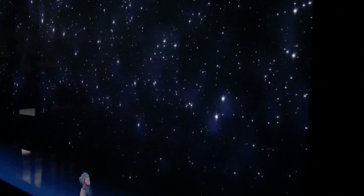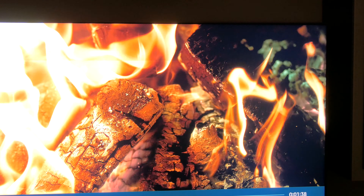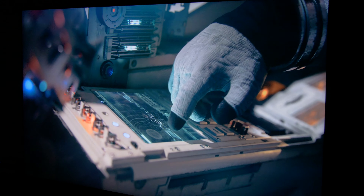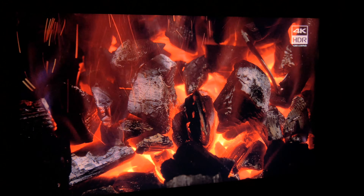Although through the camera it's not perceived the same as in person, with complicated scenes like this one, we saw some halos around the stars. This continues happening because, although the backlight control is much more precise now, it cannot turn off such small areas, and some light leakage is noticeable around the stars. In this scene, an OLED TV with self-lit pixels would show the scene perfectly, without any halos and with more detail in the dark areas, and you'd also be able to see more stars. In fact, as usual, Samsung TVs tend to dim the brightness in order to show deeper blacks, but this has an important drawback. In complex scenes, general brightness will drop, and as a result, small bright objects will be dim and there'll be some black crush. So for watching movies in a dark room, OLED technology is still the winner.